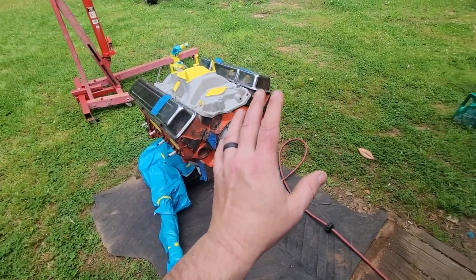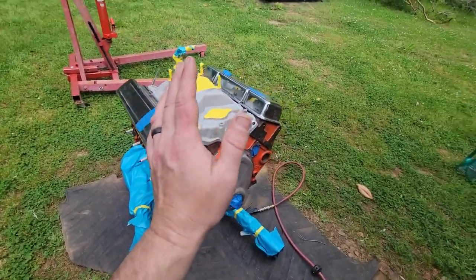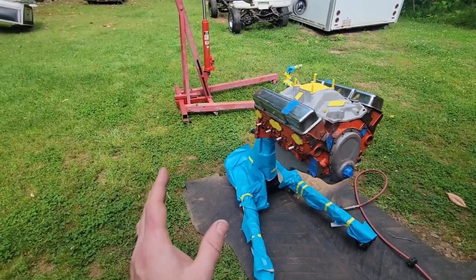The hotter it is, the better, but then it's a little harder to paint because your paint dries so quick, so you gotta run a slow reducer. So try high noon to paint this stuff, and you'll have the best amount of luck without getting bugs in it.